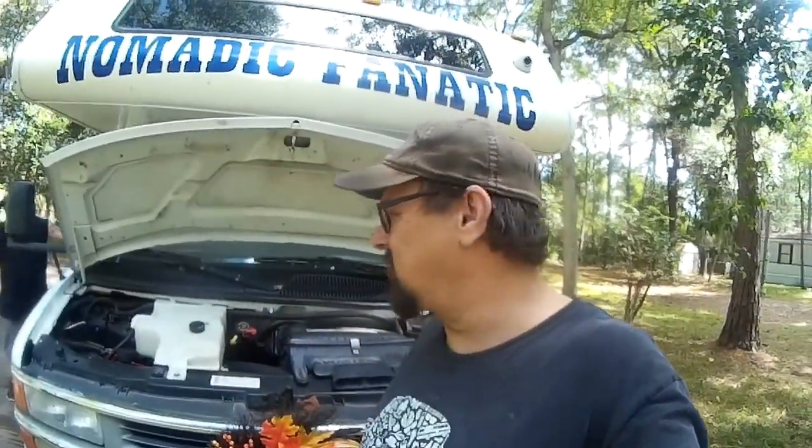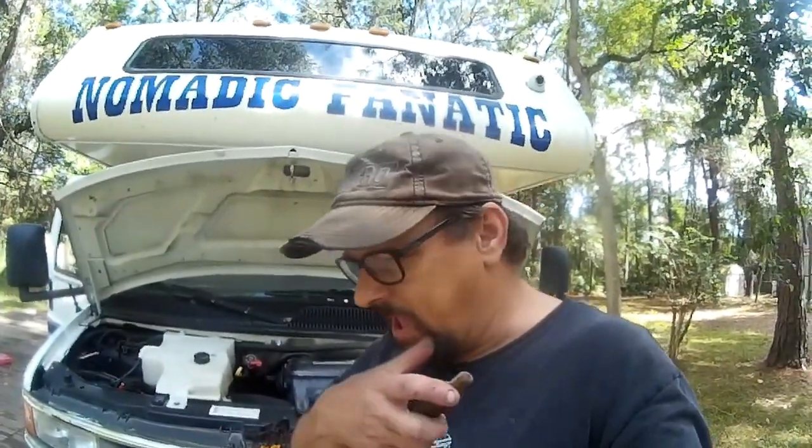Good morning, everybody. RV Prepper Wayne here. Today we're taking this out for a nice drive. Going to simulate any issues that we had before. I'm going to have my scanner hooked up, read the live data from the computer system. And as I mentioned before, we were showing a sensor that was lazy, an O2 sensor that was lazy. And knowing how to read live data is very, very helpful. A lot of people are like, if the code's not on, it's not bad. Well, not always true. But we're going to take a nice drive today and make sure everything's good.